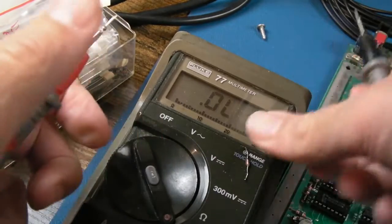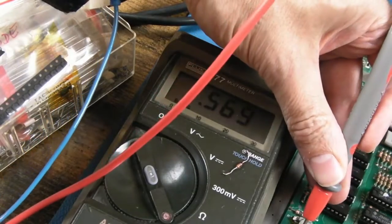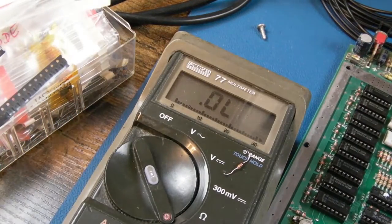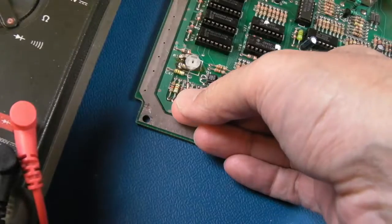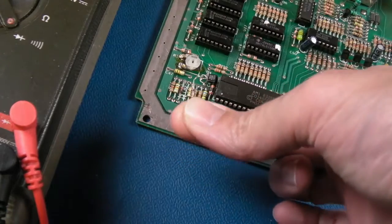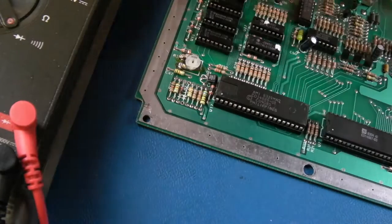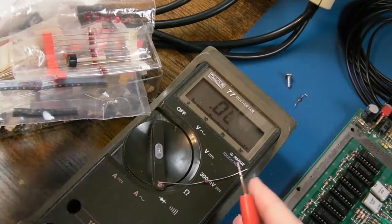Yeah, I think that diode might be the issue. Let me test the other one that's on the board. Yeah, the other one's alright. I don't know, maybe it's a red herring. I'm going to swap that diode out anyway. It's just a 1N4148. But the other clue to me, it's really light. If you look at that one there, it's like, I don't know, 2 shades brighter. It's bizarre. Yeah, that diode is the issue, because you know what, I should have followed my instinct there.